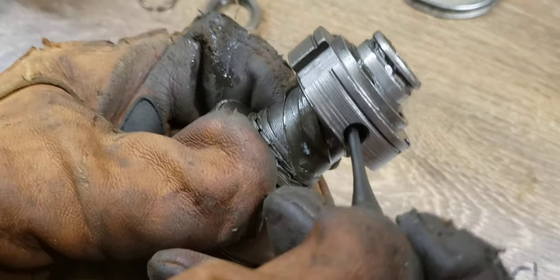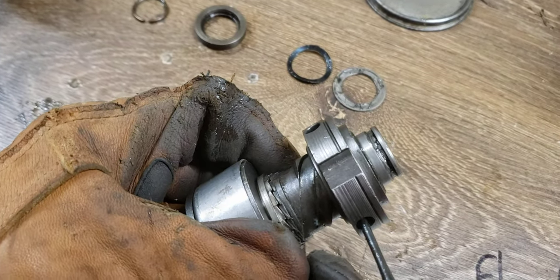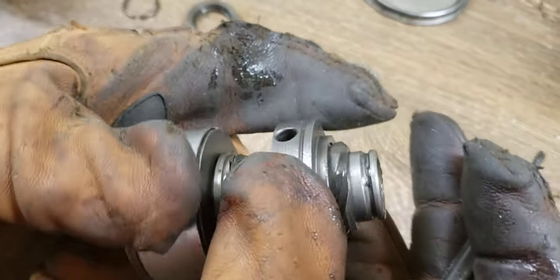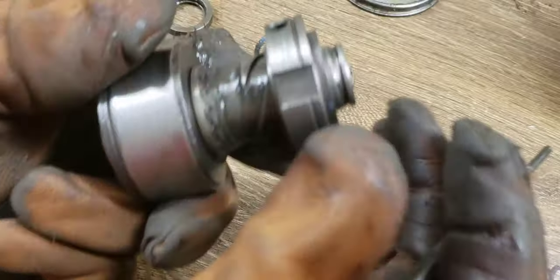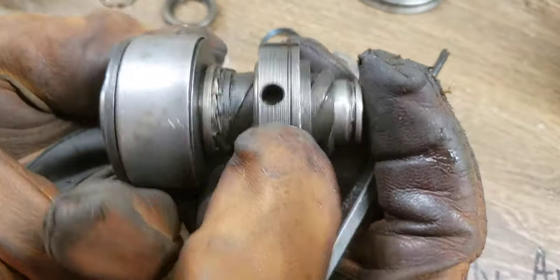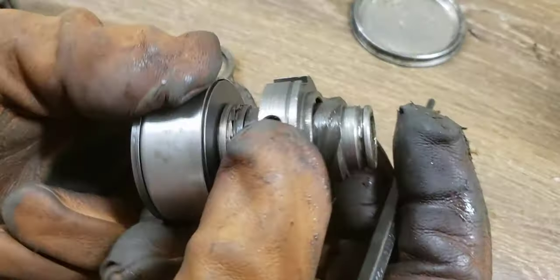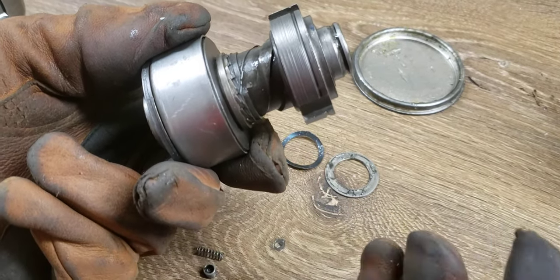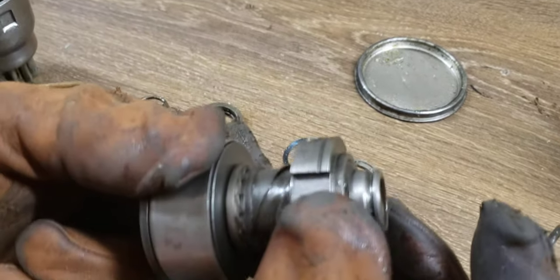It won't come back until centrifugal force throws it out and then allows it to come back. Now on the opposite end, it's slightly lower right here. When that comes over there just like that, the same buttons kind of stick in this little crevice and prevent the Bendix from vibrating out and shattering on the flywheel while the engine's in operation. But that's how it works.